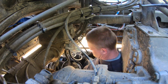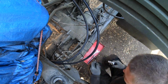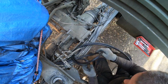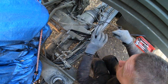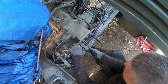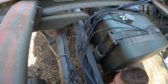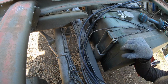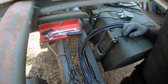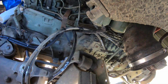What I've learned over the years is that you rarely get the routing right the first time. So don't be afraid of pulling the hose or the wires back and doing it again. This is not only applicable to the route they take, but also in relation to each other and other wires and hoses nearby. I try to get them all parallel and not crossing each other. Again, this might take a few tries and you usually don't discover the chaos that kickstarts your OCD until things are in place. Pull the wires and hoses out and do it again, but better. Also, don't be afraid of adding zip ties.